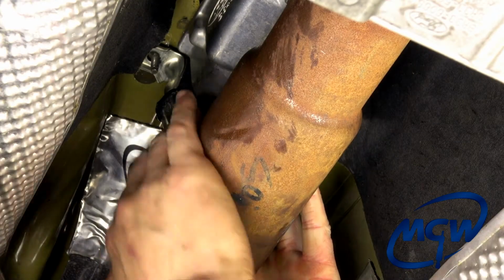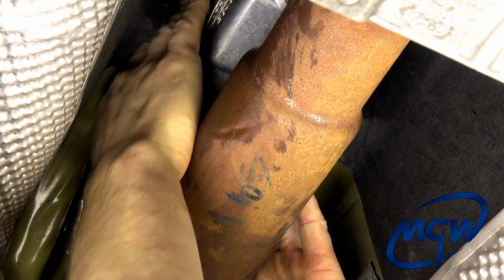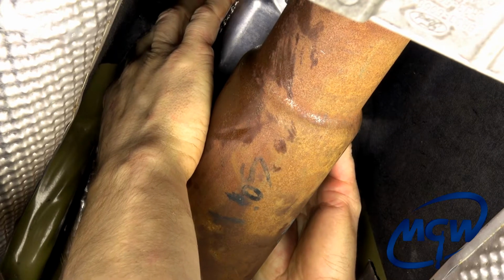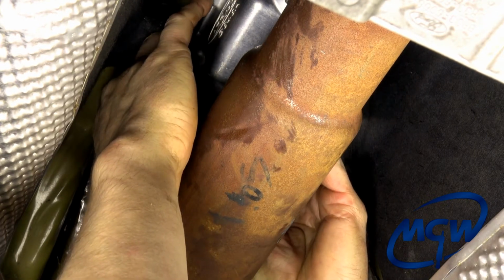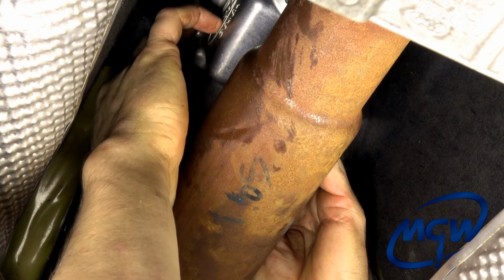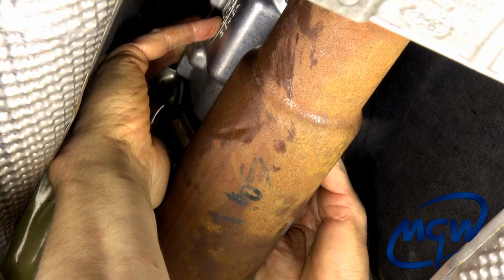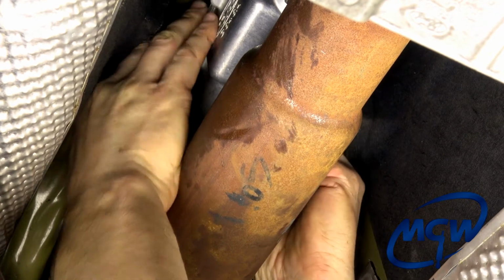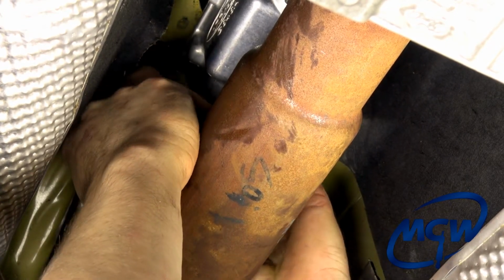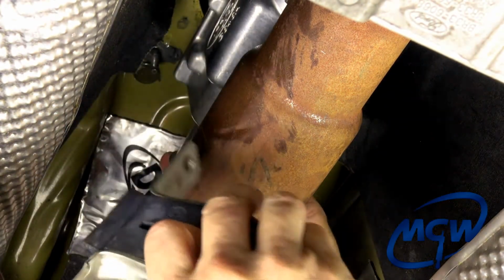Okay, once you have removed both of the 6mm hex nuts, one on the left, one on the right side of it, you're going to grab the bushing bracket and pull down on the whole shifter assembly and slide it down off of the 2 threaded studs. On the passenger side, there may be a little panel nut that works like a spring nut to hold it in place. They do that for assembly purposes. You may need to reach up on the top side of the rear bracket and pull down on that as you pull down on the whole shifter area. Once we're done that, we'll pull this off of the rear boss there and pull out the rear OEM bushing bracket.